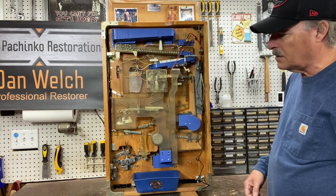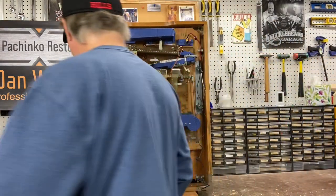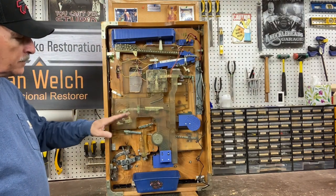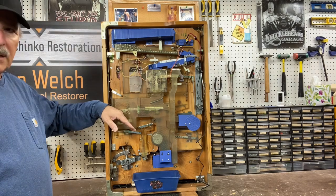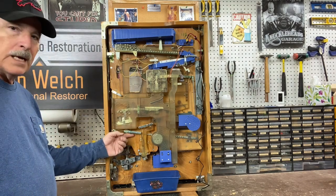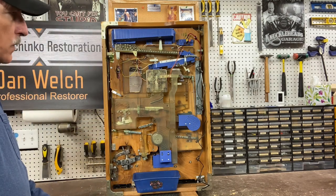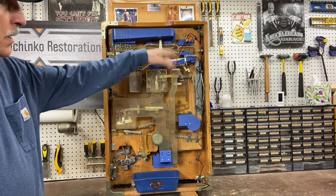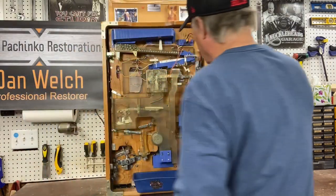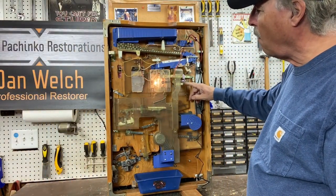Now that this is fully loaded, the only other thing you need to make sure of is that your seesaw is in the right position. The seesaw should be in this position — it's that white piece of plastic in there. It doesn't want to be in the other position; if it is, there's a little rod here you just push up on and that'll bring the seesaw up. Right now the machine is ready to go — it's plugged in, so there's power to the ball-out light and the jackpot lights. The jackpot lights are controlled by a switch over here.